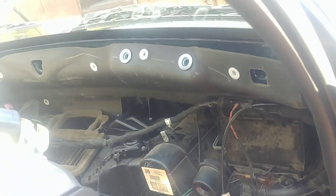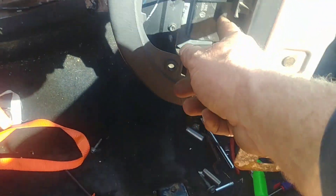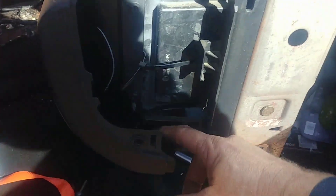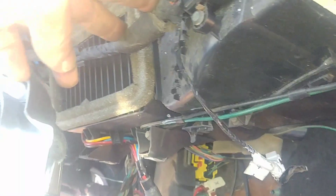So yeah, it's not bad. You don't have to remove this from the car — just loosen the crap out of it and commence the pulling. Now this will come unplugged — it goes to the reservoir on the passenger side, the vacuum reservoir. You can see it when you take this side cover off. It has another screw to hang it on there. Here's the vacuum line that goes to the reservoir — that needs to be cleaned. When you're going back together, be sure and wrap this cable into this channel so it won't get pinched in the ductwork.